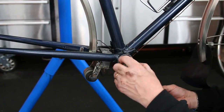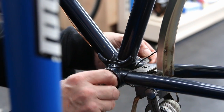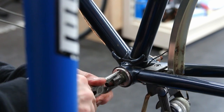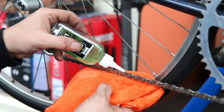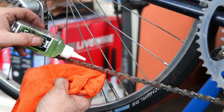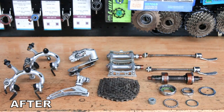You can see we've got that cup ready to go into the bottom bracket — that's one where you can get an awful lot of corrosion, because a lot of water washes down frames and collects in the bottom bracket on modern or old bikes, making them very hard to re-service. So if you grease them up nicely you get that spot on. Now you can see we're oiling the chain — you actually need to oil the rollers, not the chain itself. That's a before and after. Thanks for watching.